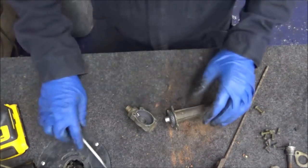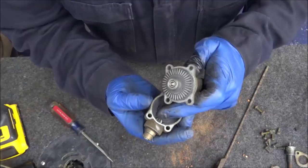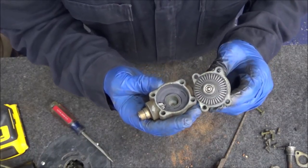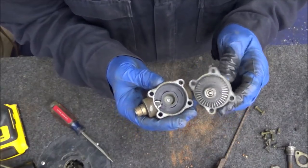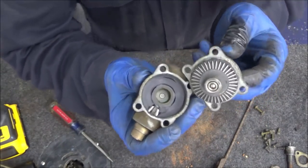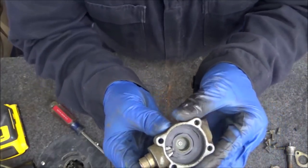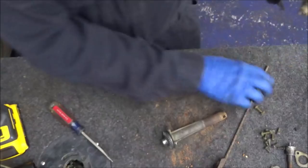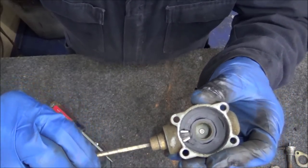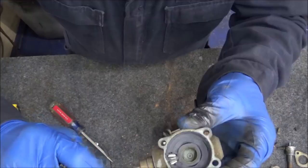The inside has all the gears and ball bearings — they're all really well-made strong steel gears, no plastic or brass. I'm a fan of how well-built these cars were. But over time when the grease gets packed in like this it's not really doing anything. As the cable turns, the motor turns it, the cable turns this little gear in here, which turns this gear. As this gear turns, this part should go down — that's how the seat adjusts.